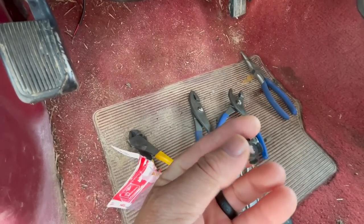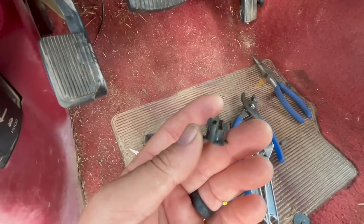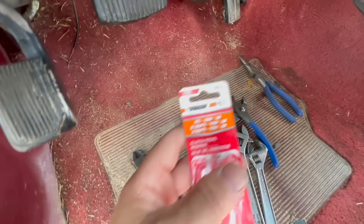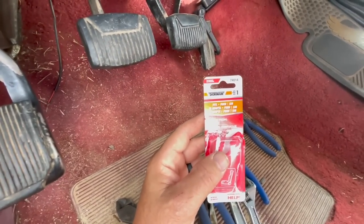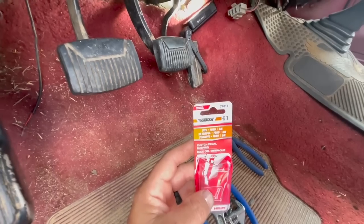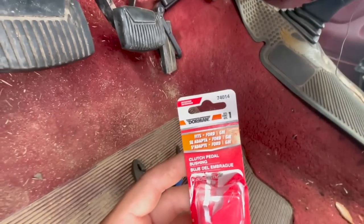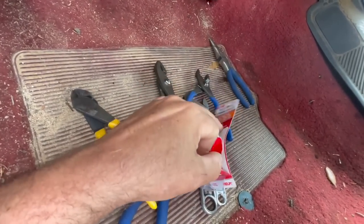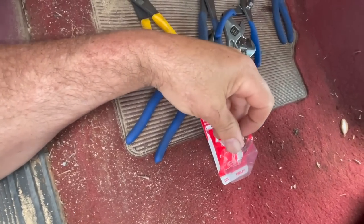Let's take a look at the old one first. This was the old one — doesn't look like there's any wear to it, but that new one went in pretty easy so I'm thinking that hole may be wallered out. This is the part number — it's a Dorman, fits GM clutch pedal bushing. Part number up in the top right corner: 740147.